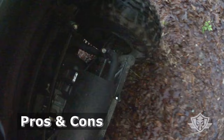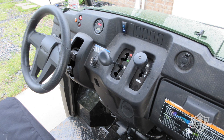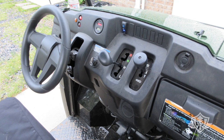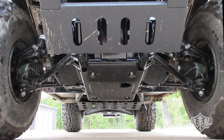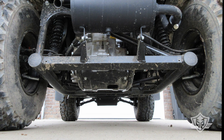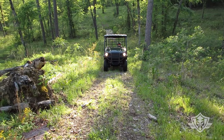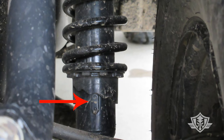Let's take a look at the pros and cons so you can get a sense of the strengths and weaknesses of the Mule SX. For the pros, generally speaking, the Mule SX is rugged, simple, and well-built. As you would expect from a major player like Kawasaki, it doesn't have unnecessary complexity or useless auxiliary systems that can break or fail. It has a good, stout, tubular frame with independent suspension up front and a solid transaxle with spring struts in the back. The suspension travel is minimal and somewhat stiff, but it's adequate for the Mule's intended purpose and for the casual jogging pace at which it travels.